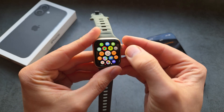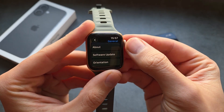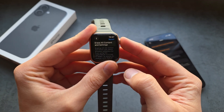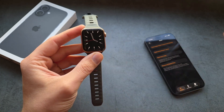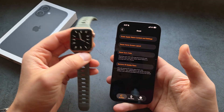If you do not have access to your old iPhone, you can also do it from the watch settings over here. In settings, general settings, you also have this reset option. However, this option sometimes doesn't remove the Apple account lock on this watch. So again, I highly suggest you to do it from the iPhone app.